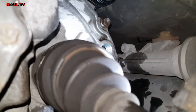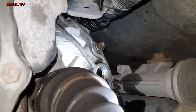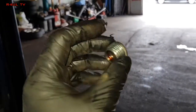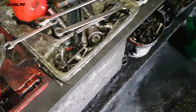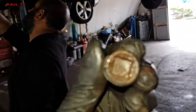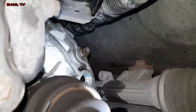As for refilling the gear oil, I would recommend you fill it with ATF — automatic transmission fluid — it's stronger than normal gear oil. Take that Allen key plug off on this side — that's the filler plug. It's a square Torx head, same size as a 3/8 socket drive — you could use a 3/8 ratchet head, it might be a little bit loose but it'll come off. Get a squeezy bottle and just fill it up. When the gear oil starts coming out that means it's topped up — all done.